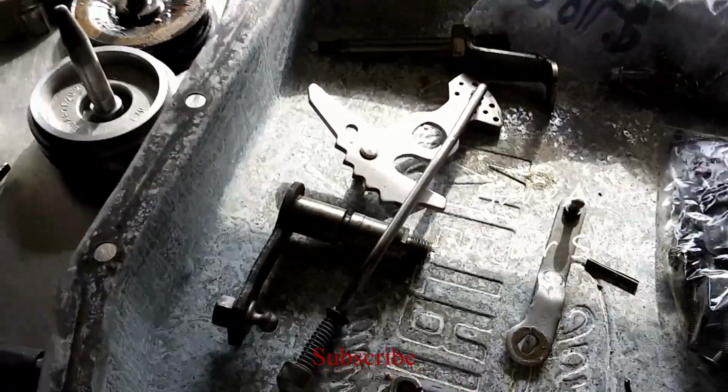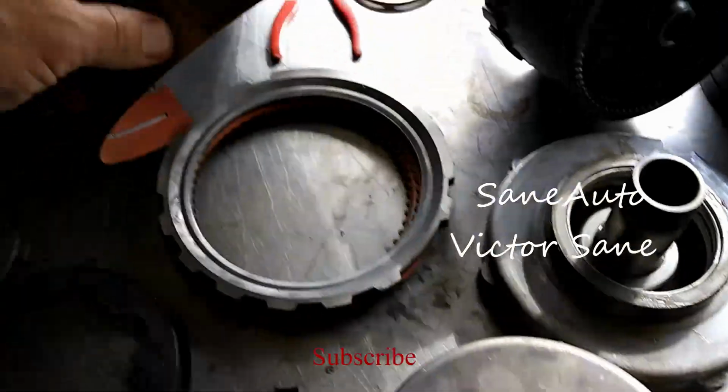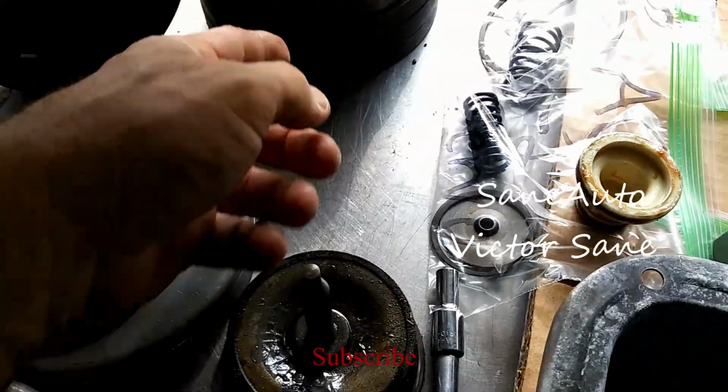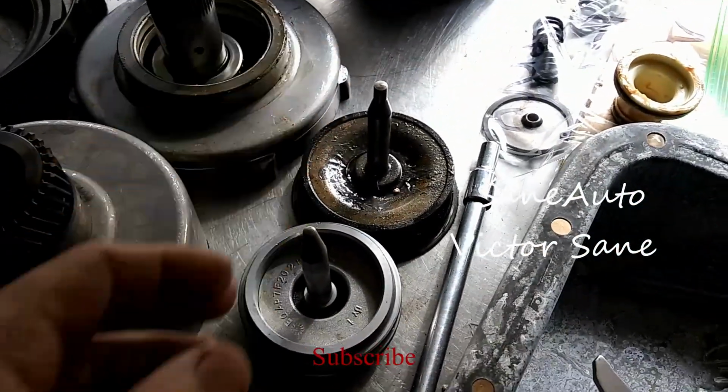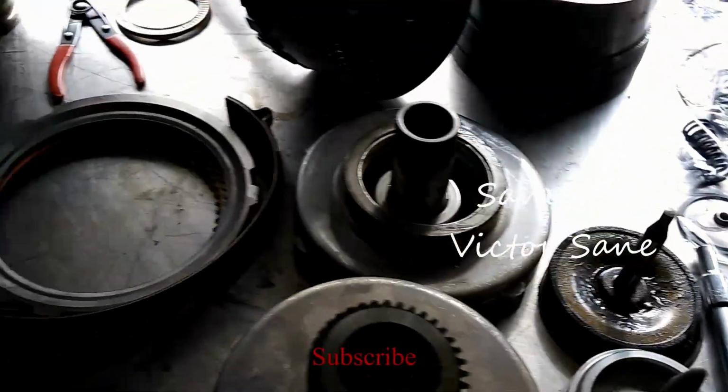It's pretty thorough. Next, you're going to want to take the servos out for the front band and the reverse band, because you're going to run into problems if you don't have those out before you proceed. Then comes the pump.